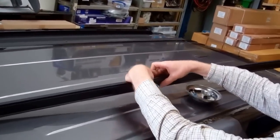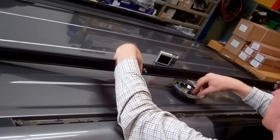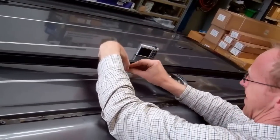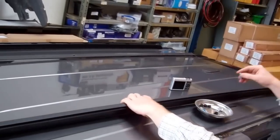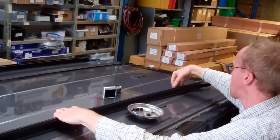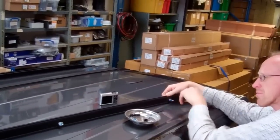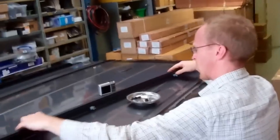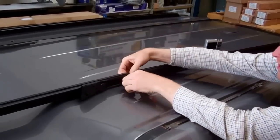What we'll do is get the bits on the car and show you how it all goes together. We'll take the bolts and drop them through from the top so they're coming through like so. Then we need to fit the little spacer over it, and then put the little keeping-on washer on. We need to do that for all four — it might be easier to do this on the bench, but we'll do it on the roof. At this point we only need to do the back three.